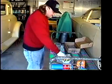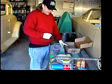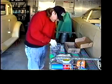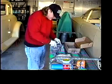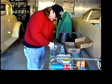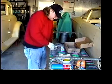There's a spot I did real quick already with lead, and we'll have to get the other side. Now, to begin leading, you must properly tin your metal so that the lead will hit. And I use a dry alloy in order to do that. So I start with a little bit of the dry alloy in a cup. I add water to get the consistency that I want and form a paste. And then I'll heat the panel up enough for the alloy to stick.